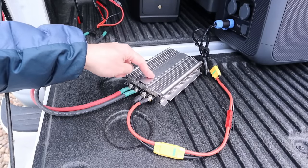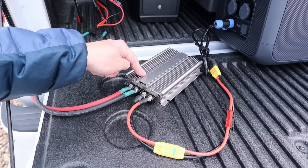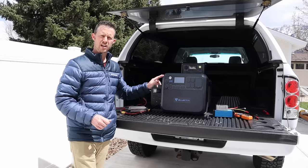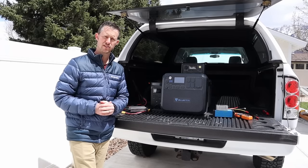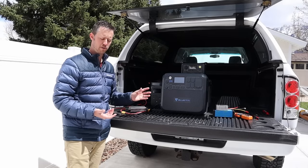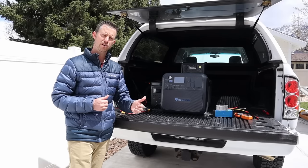Just remember this one does get pretty warm after a while. On a cold day like this with wind blowing it would stay pretty cool, but if it was enclosed in a hot environment you'd want to make sure you have a fan blowing on it so it does not overheat. This has been running for about 15 minutes and the power station's almost full. I'd recommend looking at your alternator and what its rated power is. For my truck it's rated at 170 amps at idle and 270 amps above 1800 RPMs, so we're not close to maxing it out. But if you had a smaller car or minivan, your alternator may be a lot smaller. I would recommend staying under 50% of the rated output of your alternator.